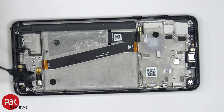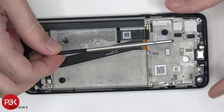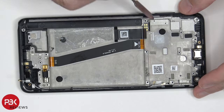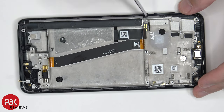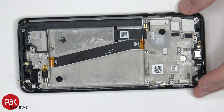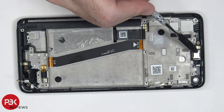The vibrator motor is located right over here on the bottom. The enclosure or housing for the stylus is located over here, and here's your stylus. The flex cable for the power button and volume key is located right over here, and it is routed through the midframe over here. So if you ever had to replace that, you would have to pry the screen off to gain access to that cable. The earpiece speaker is located over here on top.